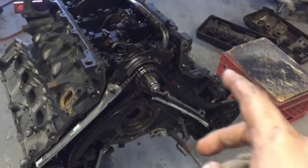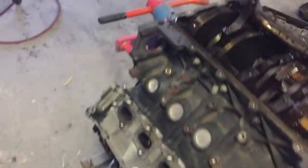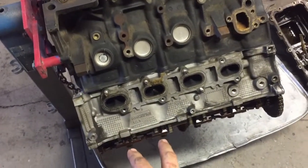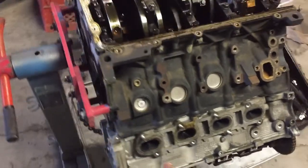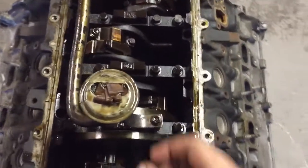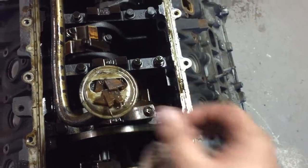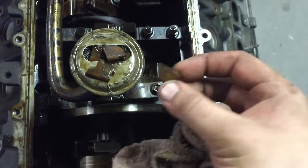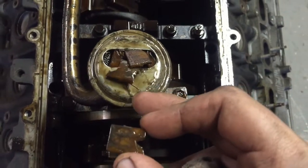One other mechanic that had known about this engine said it had a dead cylinder, and sure enough these two rear cylinders are dead. When you hook it up to air on top dead center it just blows out through the exhaust, so I've got two dead cylinders leaking out of the exhaust. When they replaced things they didn't even take the pan off to check for broken material. It's sad when people are selling you 'good' engines when they don't even take proper procedures to clean them up.